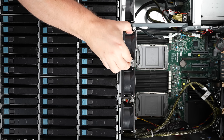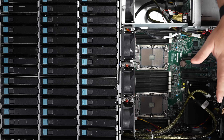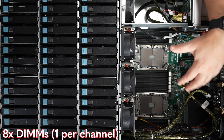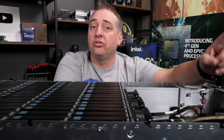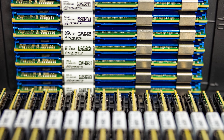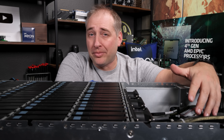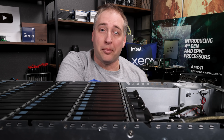What you'll see is that we can pull the fans out — that's one of the hot-swap fans. Then you'll see on the system that we do have our two third-generation Intel Xeon Scalable sockets, and each CPU has eight DIMMs. You can run both standard memory as well as Optane DIMMs in here. Most folks though are just going to use standard DDR4 memory. If you want Optane, for example as a logging device, you'd probably put that in the NVMe form factor on the back.